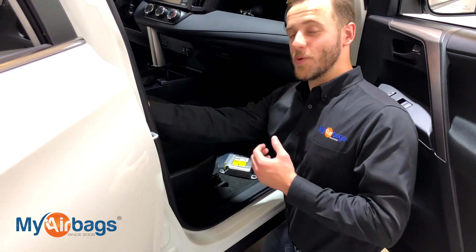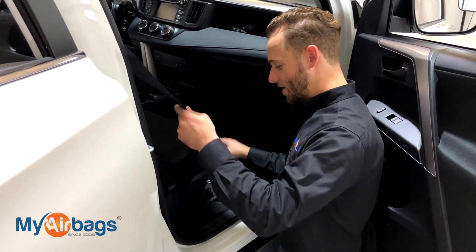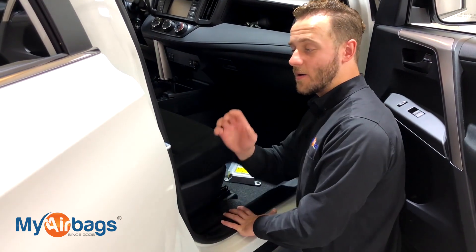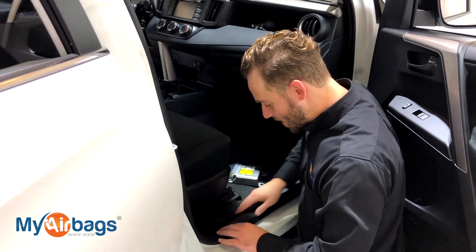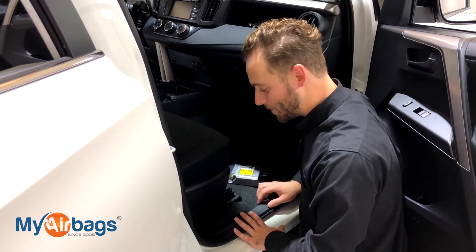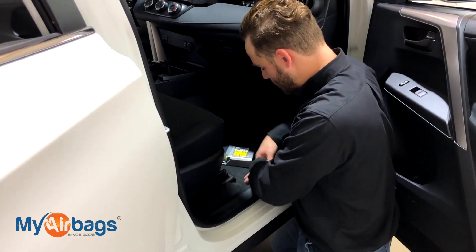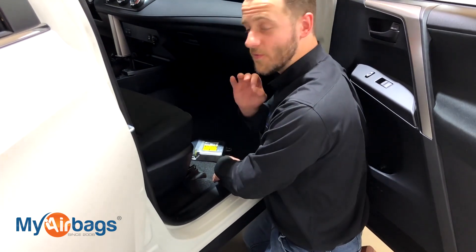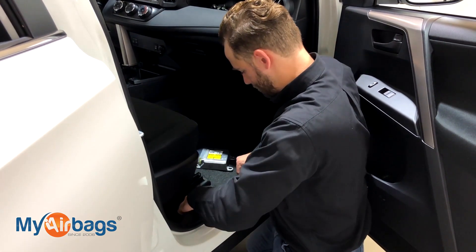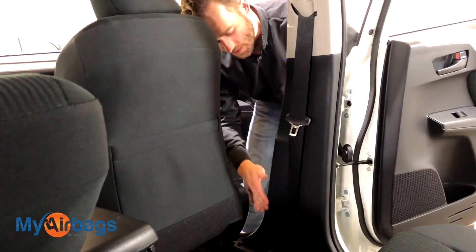Now if you're someone who rebuilds cars regularly, you already know that the seat belts deploy along with the module. We can actually rebuild the seat belts for you, and we're going to briefly take a look at how to remove them. We want to start by getting to the side panel, but the side panel runs underneath this panel right here, so I want to start with this, pull it up, and then get into the side pillar. I'm just going to use my hand to get right between the carpeting and the panel — you'll hear a few pops and that's normal, that's just the tabs coming right up. Now we're going to keep working right up into this side panel here.